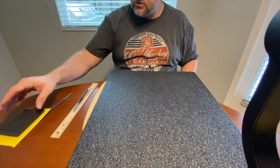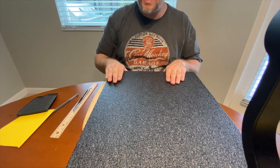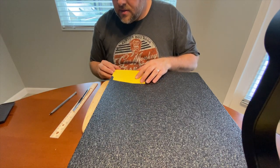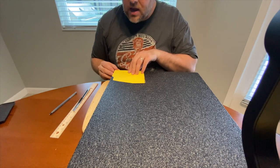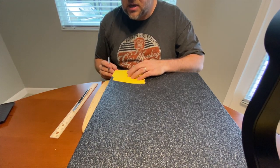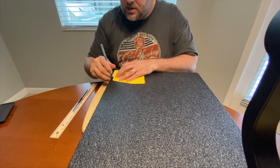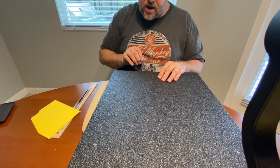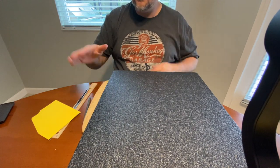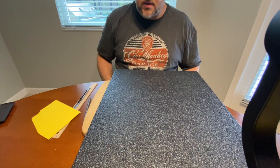Then I just used a little knife and a ruler and cut it out. This is the foam I'm going to use — it's not styrofoam. It has a little give to it, but it's still very firm. It's not closed-cell foam because that's really dense. This is somewhere in between, very easy to cut with a razor knife, very inexpensive. And because it is somewhat dense foam, you'll be able to glue it to itself to stack and fill up the area. I traced it out using a regular pen, which writes on this foam just fine.